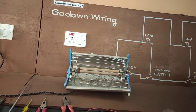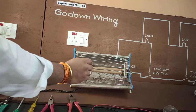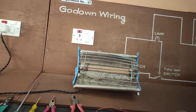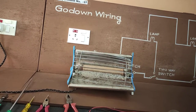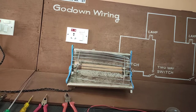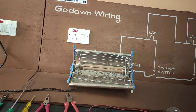In this room heater, there are mainly two parts. The first is the heating element or coil, which is made of nichrome — 80% nickel and 20% chromium. This nichrome has high resistance and is flexible in nature. The second part is the reflecting cover, which is made of steel.